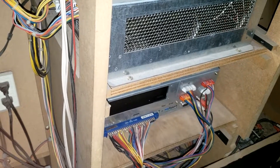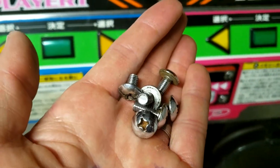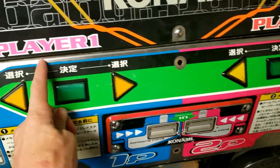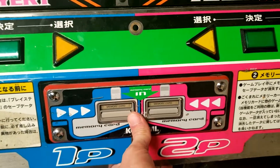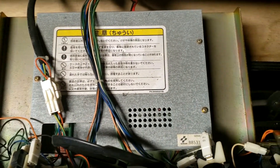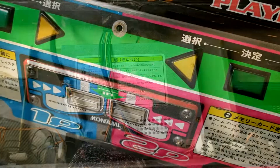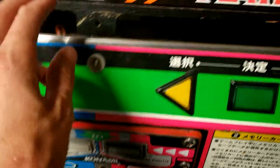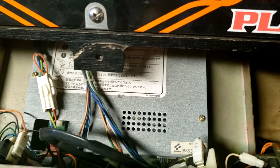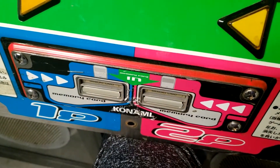Let's get on with it and take out the memory card unit. First thing to get this bezel off: we're going to take out six screws - this one, this one in the middle, same below, and two on the other side. With the screws removed we're just going to slowly pry on this, pop it out from under here, lift it up, and pull it out. Inside there's the front ports where you put your memory cards in, and a memory card module - this whole big silver box - which ultimately plugs into the 573. People get disappointed buying these on eBay thinking they only need the port section, but you actually need the whole module too - it interfaces the 573 with the slots. If you don't have this module, don't buy the card units - you need both items for the cards to work.